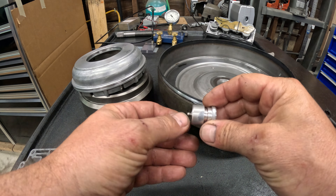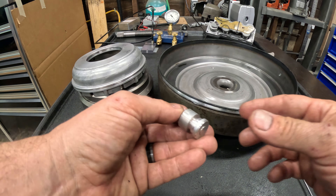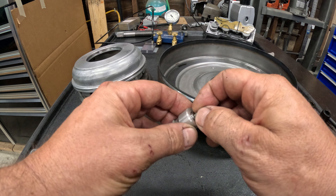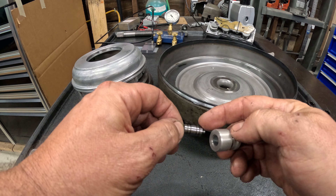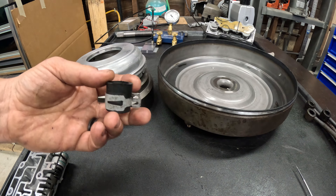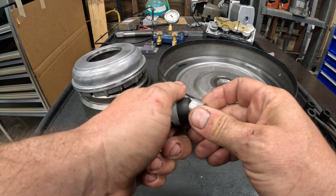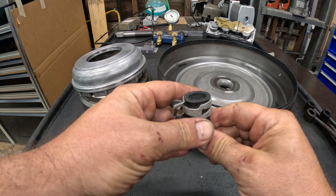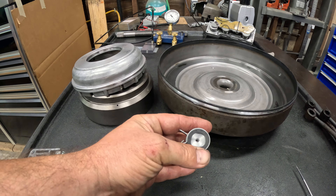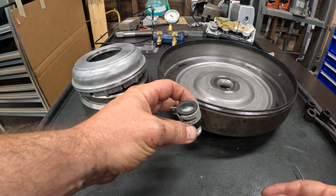This is a line pressure modulator. When I check these I check them twice — first as an assembly with the plunger and the sleeve, and if it passes I'll test it inside the valve body to see how the sleeve-to-body seal holds up. This one didn't pass the initial test. The way I do it: I have a piece of three-quarter inch hose with an aluminum disc cut down and drilled inside it. When I apply the hose I'm sealed to the sleeve and I can apply vacuum across it. The disc prevents the vacuum from pulling the plunger out, so I can get a clean vacuum reading.